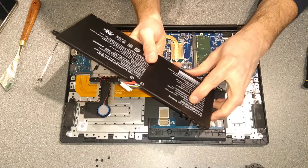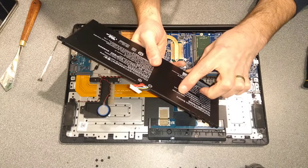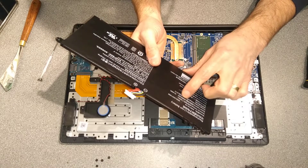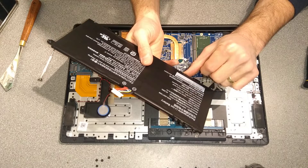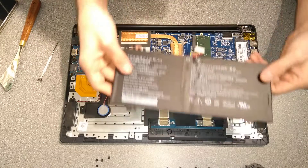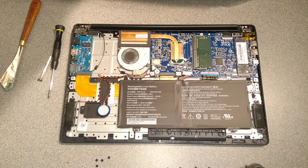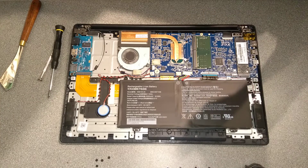The model number of the battery, if helpful, is 4588105-2S, and the MSN number is 40071698. It's 7.6 volts and 6000 milliamp hours, which is 45.6 watt hours. I need to buy another one and fit it to see if it solves the problem of the machine not charging and not lasting very long on battery. If this video has been helpful to you, it would be really helpful to me if you wouldn't mind subscribing to my YouTube channel — the subscriber numbers really do help. Thanks very much.